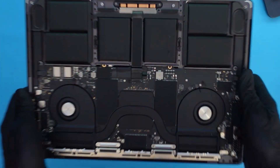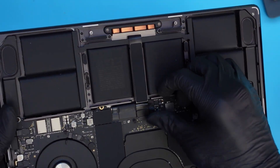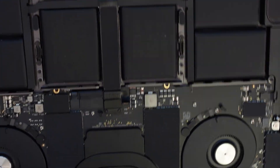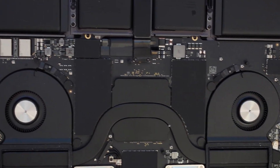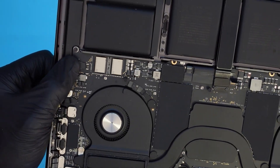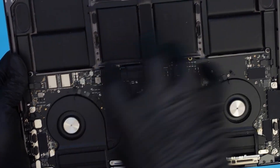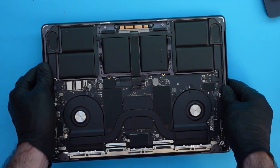Let's open the bottom cover. We can already tell somebody tried to open the trackpad and the battery connection — we can see a flap up and a stripped screw. They probably just unplugged the battery to see if that would change anything. It looks very clean overall with no obvious damage or dirt. Annoying when something is this new — you'd expect maybe liquid damage or a firmware problem, those are usually the two things. But everything's soldered completely, so a failure anywhere can make the whole device not power on.